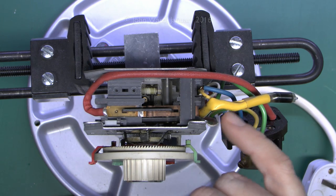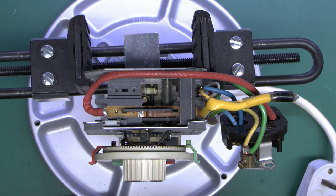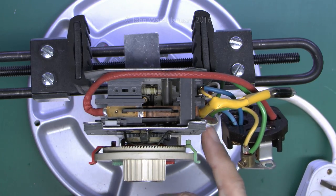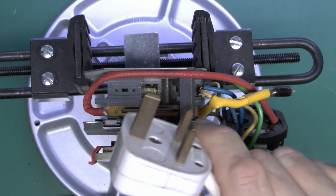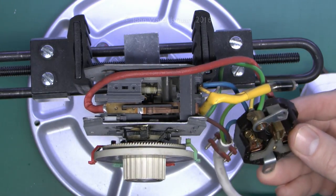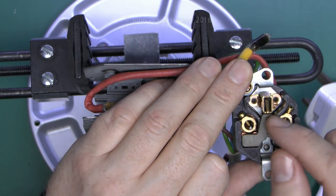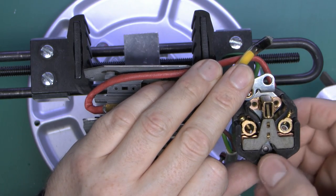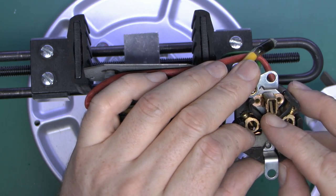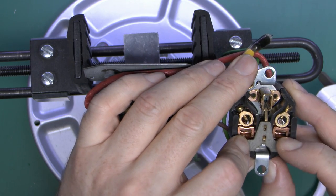It appears that the neon is actually wired across the incoming supply, so it would be on all the time and not actually switched by the timer mechanism — it's on the brown wire which goes to the incoming plug. Only this red wire from the switched side is the actual switched output. The MK socket is totally standard for that era — you've got your three contacts, the plate forms the covering over the front, and when you insert the earth pin it moves down to reveal the other two socket holes.